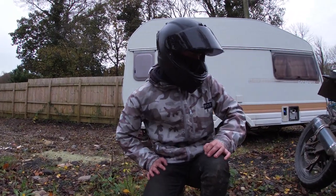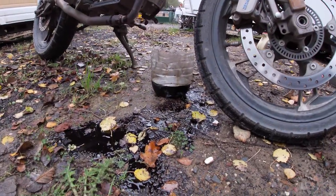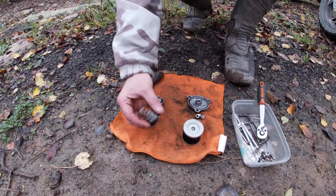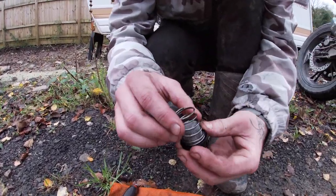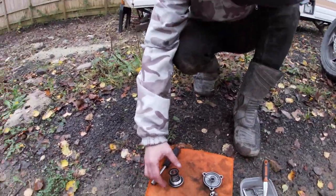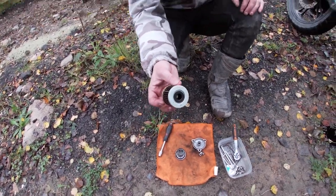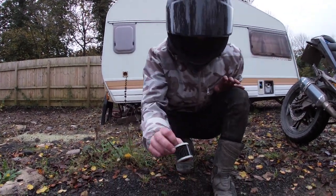The oil's been draining for about 10 minutes. I've moved it side to side like you've seen in the video. As you can see, that's all the excess oil that came out just from moving it side to side. Everything's cleaned up and ready to go back in. Got the sump plug, got the spring for that. That only goes in one way because of the filter. We're going to put the oil filter in first — it can only go in one way, that bit sits at the back and pushes in. So it just sits in like so. I'm reusing this one because there's nothing wrong with it.